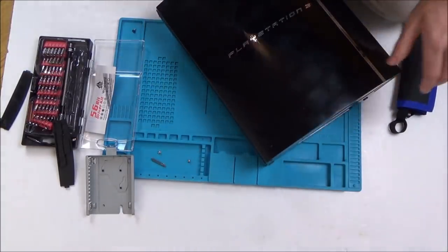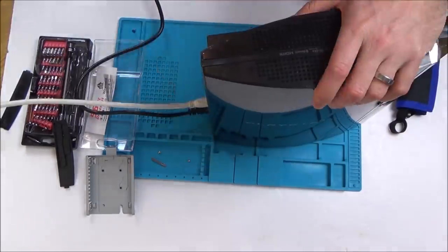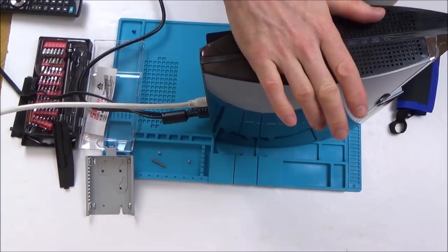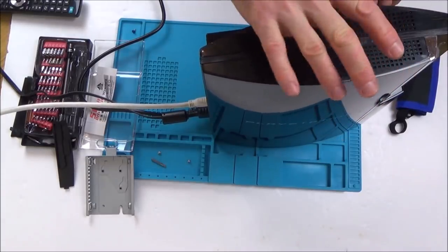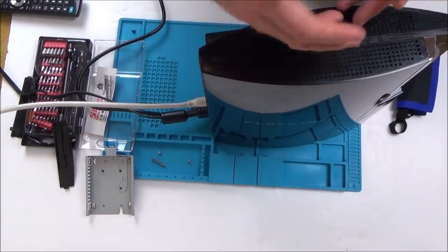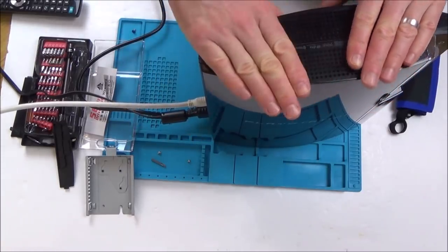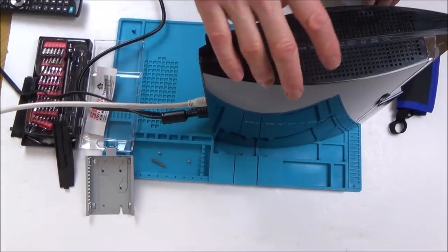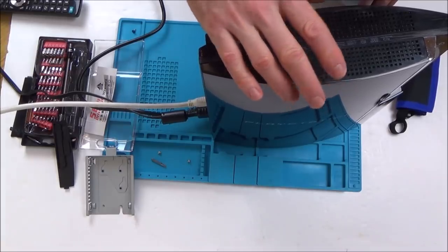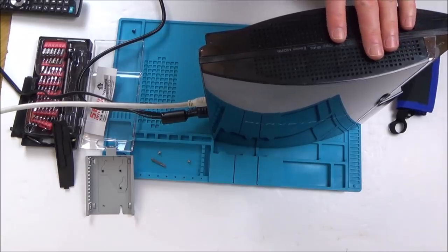With the hard drive in it still makes a startup sound but it's not working on AV or HDMI — I've still just got the pixelation on both. When I hold the button to swap the input over to AV the pixelation then occurs on AV. So it all appears to be working, it's just not displaying on screen. It's absolutely redundant as it is. The display must have gone, it was probably not repairable, and maybe the original owner took the hard drive out for security. I'm going to pop that hard drive back and concentrate on taking this apart.